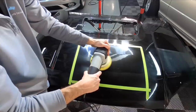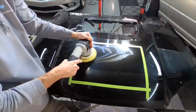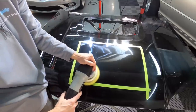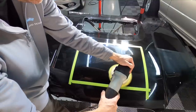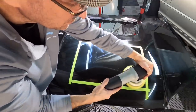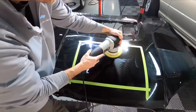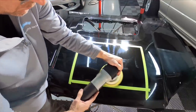I'm hoping this gives you the best view of what I'm doing and how to do it. Just cleaning out your pads before you jump to the next panel. At the very least, I like to do pad cleaning in between every pass — keeping the pads clean keeps them effective. I have my own customized pad cleaning cabinet, but all you really need is a pad cleaner and a brush, then wipe it off with a microfiber — an old junky microfiber.